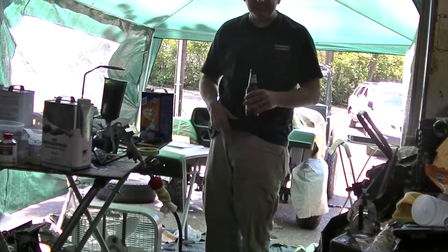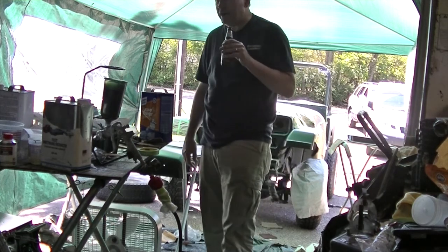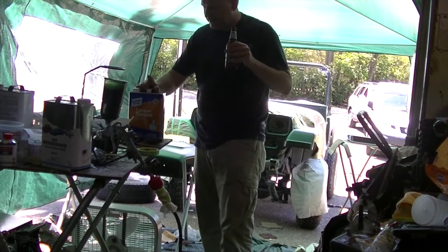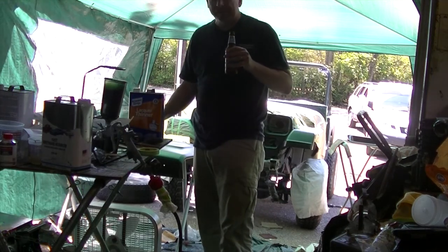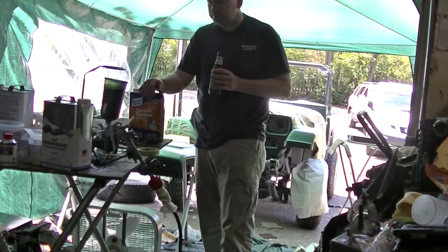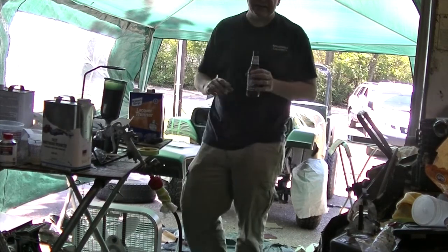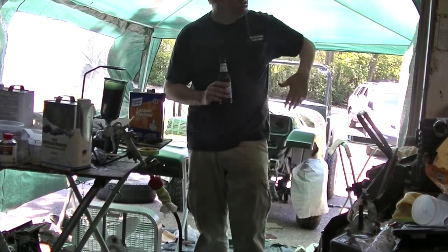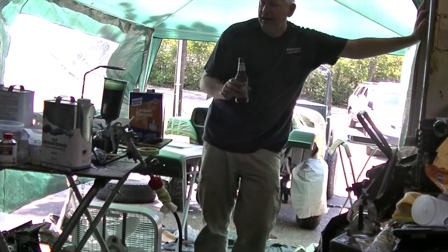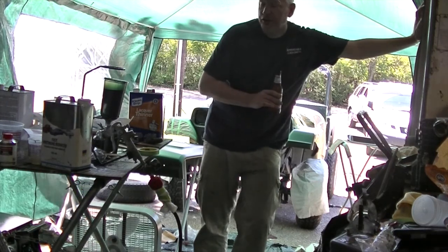We're in mid-painting beer time. It's going on really well. The old Harbor Freight spray gun is doing better than the DeVilbiss — so go figure. That was a waste of a hundred and two hundred bucks for that set. I'm letting it flash out in between coats to make sure I don't get any solvent trap. It's a perfect temperature for painting, about 72 to 74 degrees. I'm using a 70-degree reducer on the base coat, so it's looking really nice.